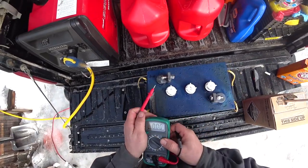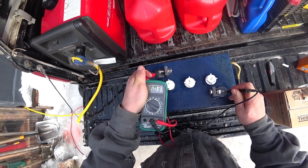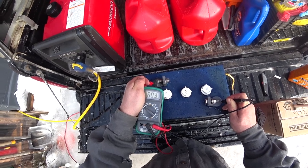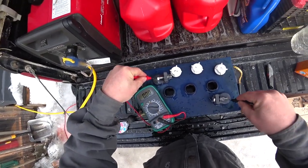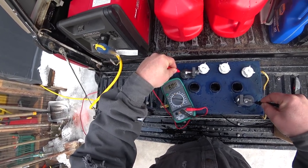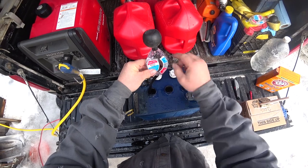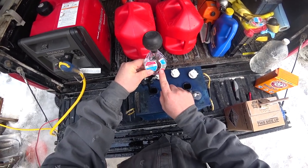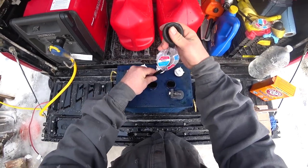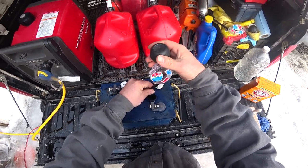The electrolyte has been in the battery for just a couple minutes while I did some cleanup. I want to see if my experience is very similar to that of the previous battery. When I changed the electrolyte on the other battery, I got an instant voltage increase. Before the electrolyte switch on this battery, it was at 5.95 volts, and we're now sitting at 6.08 — just with an electrolyte switch. Also worth noting, the specific gravity of the electrolyte added is much closer to the fair category. The previous specific gravity was not even registering.